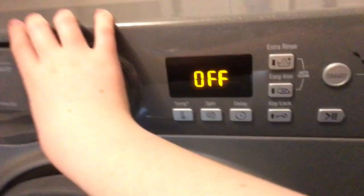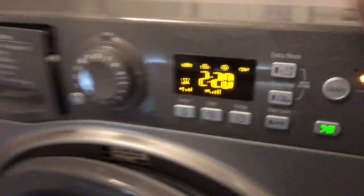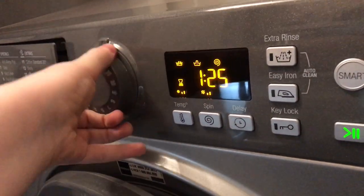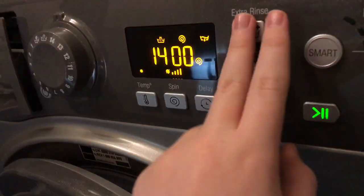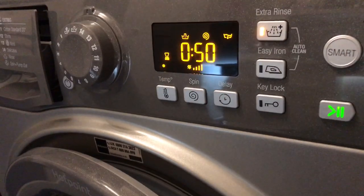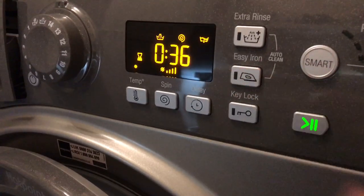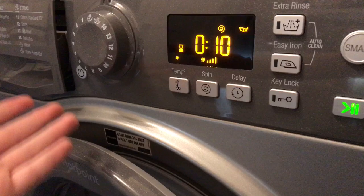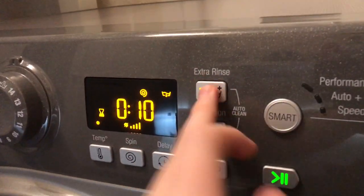The anti-crease symbol indicates a full cycle: wash, rinse, spin, and anti-crease tumble. Some cycles like cycle nine don't include anti-crease to save time. There's also Rinse Only - cold wash only obviously, 1400 rpm default, doing two rinses; adding extra rinse takes it from 36 to 50 minutes with an intermediate spin added. Spin Only lets you choose up to 1400 rpm but no temperature or smart options since there's no water involved.